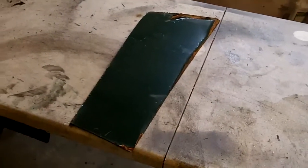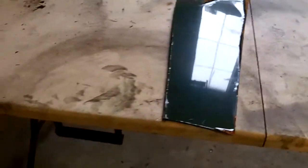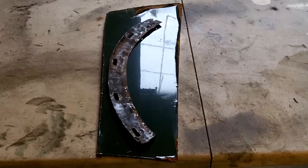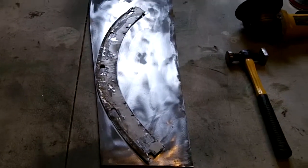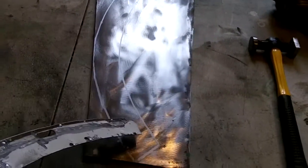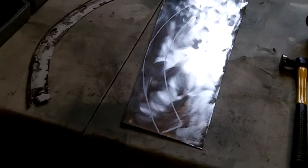We'll come back in a little bit. Figured while I was cutting I'd cut a little bit bigger piece — I know I can use some scrap for other repairs I need to make. So I got a little bigger than I need but figured while I was cutting it from the hood I might as well. Anyway, I'm going to clean that up, mark it out, and make another cut. Got the piece pounded down flat and marked out on the sheet metal. I'll probably do a few different cuts with the cutting wheel first to trim the excess, then go in with a pair of tin snips to finish the fine cutting. I don't have a plasma cutter or anything fancy so we'll do the best we can with what I've got.